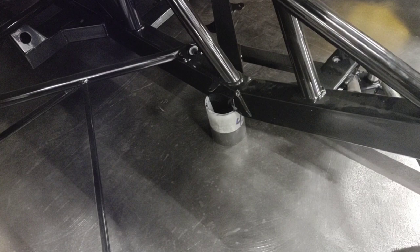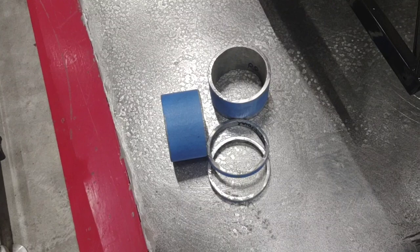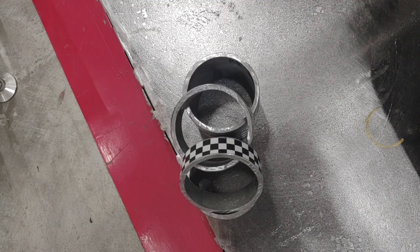I've got my 4-inch setup blocks, which is 4-inch on the left front, 4.5 on the right front, 4 3/8 left rear, wherever. That's just my setup block. I've got another set of setup blocks. That's the blue set, which is my maximum travel blocks. They would basically show if my crossmember is just touching the ground, plus my maximum travel in the rear. And then I've got my checkered set, which is my zero ride height block set.